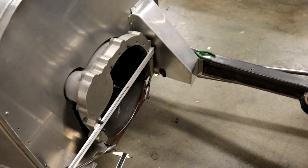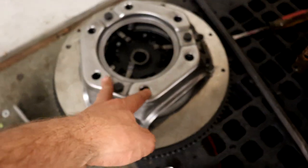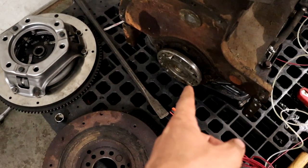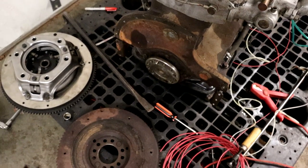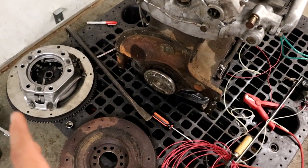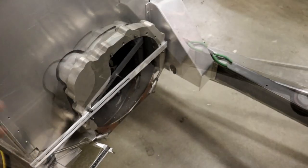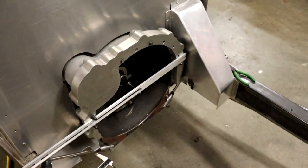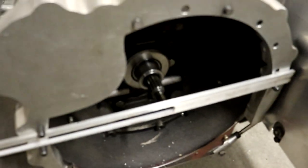I adapted that together with some custom adapter plates. The way it was supposed to go was: Jaguar engine, then a custom adapter plate to go to a flathead Ford bell housing. This flathead Ford flywheel with a new pressure plate — I machined the back of it to fit the Jaguar crankshaft and machined a new bolt pattern in it, so essentially the back of the engine becomes a flathead Ford V8. That made it easy to go to the T5 transmission, since that's a very popular conversion, letting me buy off-the-shelf throwout bearings and adapter sleeves.